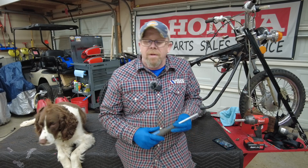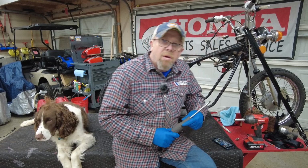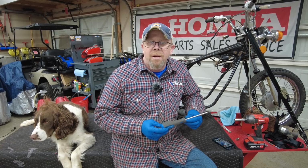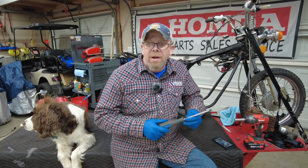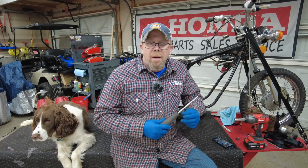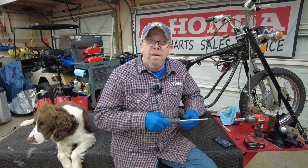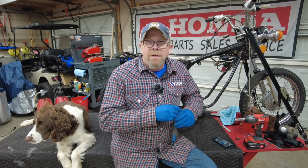I also want to mention that when you work with the screws on these old Hondas, they're not a standard Phillips screw like you're going to get at your local Home Depot when you go to buy screwdrivers. You're going to have to get some special screwdrivers, and they're called JIS screwdrivers, Japanese Industrial Standard. And I don't care who tells you different, they are different. They are not the same as what we know as an American Phillips screw. A standard American Phillips screwdriver will just basically back itself out of the screw head when you try to loosen it, whereas these are actually profiled correctly to fit in those screws.